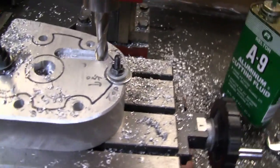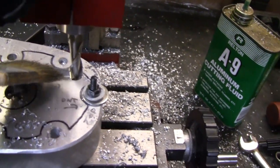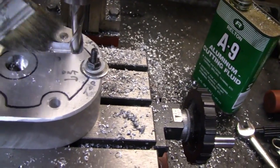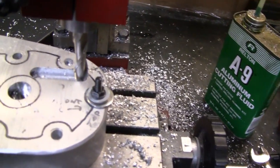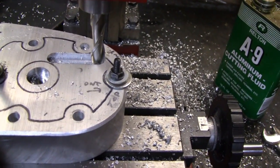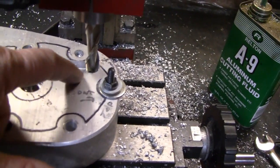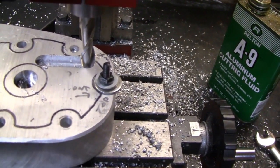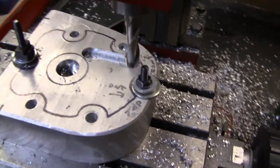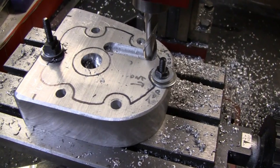I've got this over on the little mill here and I've been playing with it for a while. That's the problem with these little mills — they'll do the job but you better not be in a hurry. This little section might have taken over a half hour. What I think I'm going to do is take it out of here and bring it over to the drill press, drill holes through it, and dig out a lot of the meat. That'll cut down on the milling — it's a little Rube Goldberg, but sometimes you've got to do that.